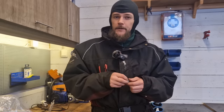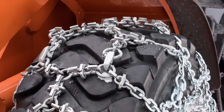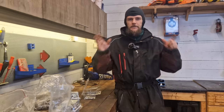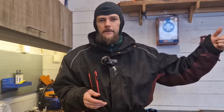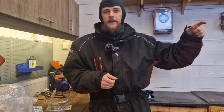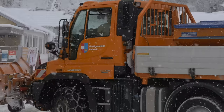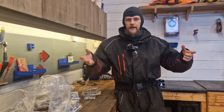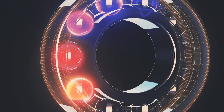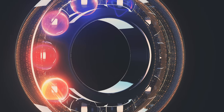As for the reason I'm not using snow chains — there are many reasons. One is I don't even think there would be space for snow chains on my rear wheels; they would hit the fender because you're not getting your chains completely tight to the wheel — there's going to be some throw in them and it would potentially break my fenders. Also they're a pain to drive on at any high speed, and the chains also mess up the balance of the wheels, which really exposes wheel bearings when going at higher speed.